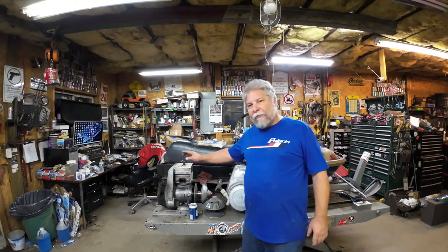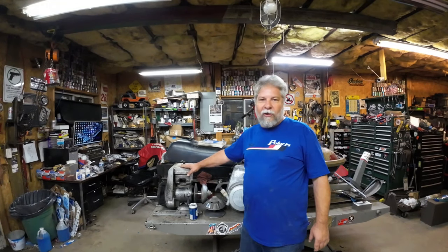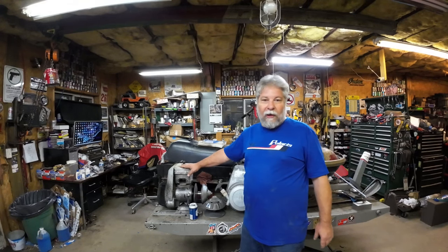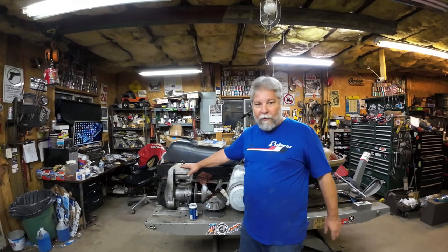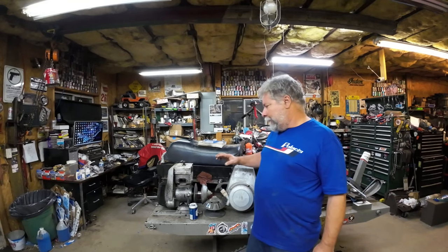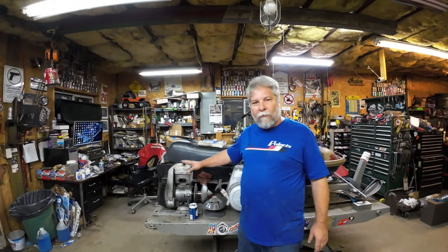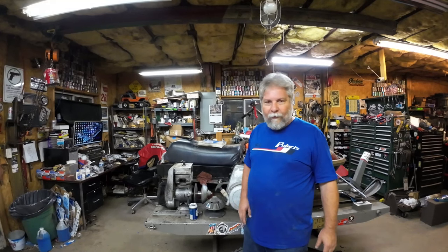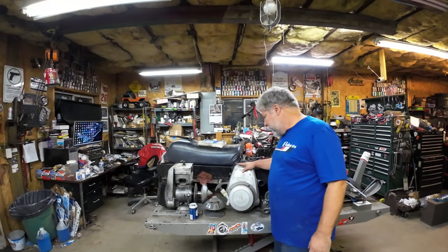Here's the engine — this is the motor that's coming out. This is a JLO L295. It makes about 19 horsepower with an HD carb, but I had an HR on it because I was going to run it in some class that I never did — it just stayed on and worked. So, not great on power. Poor sled probably couldn't break 40 miles an hour with that motor, and part of it was probably the clutching too — she really didn't spin too fast.